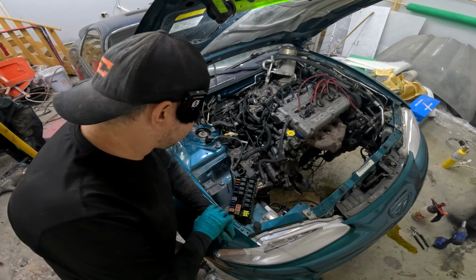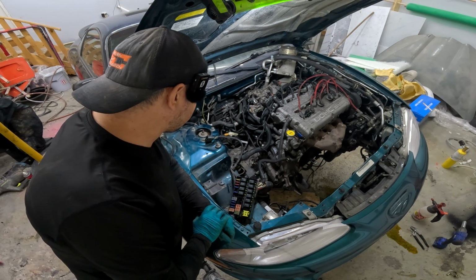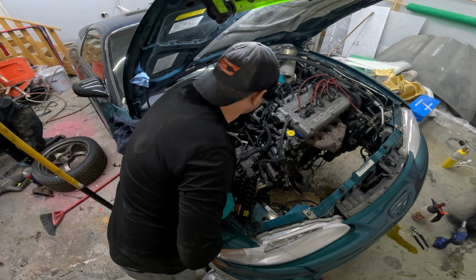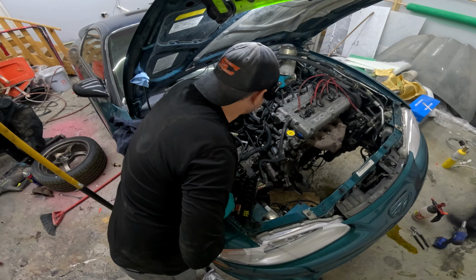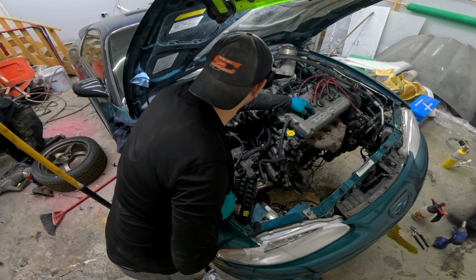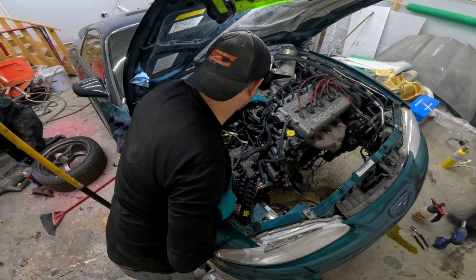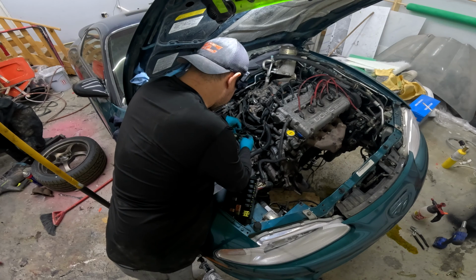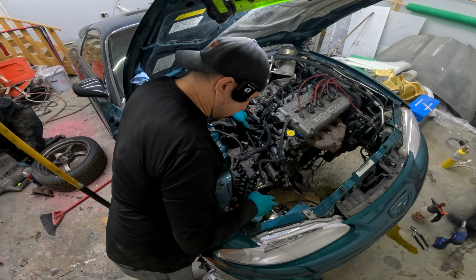All right guys, it wasn't bad, quick 30 minutes. So we've got a few things happening here. We do got a few broken connectors. Oh, I just noticed that one there, although I suspect I broke that one. This one, the little mount is broken on it. Extra MAP sensor there. We're gonna need a throttle body gasket. Lots of random connectors, although I pushed the starter wires down there. There was an exciter wire and the main wire for the starter that was up here.